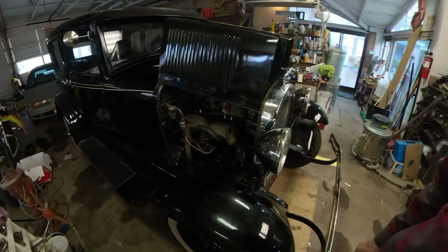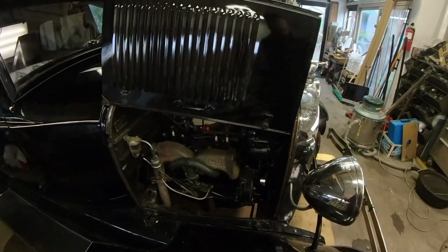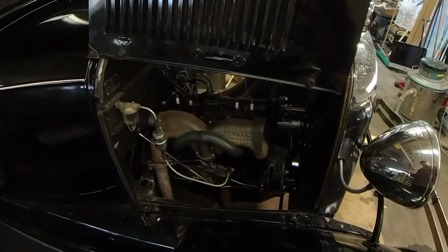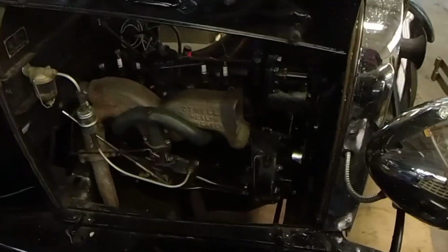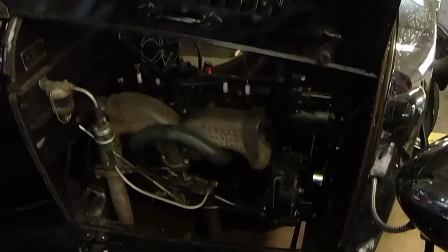This one had been leaking under, in the inside of the engine, and had rusted the studs solid, the head studs, and it took me about a week to get off of that. And in the process, I cracked the head, trying to get the thing off of there. It was quite a job.